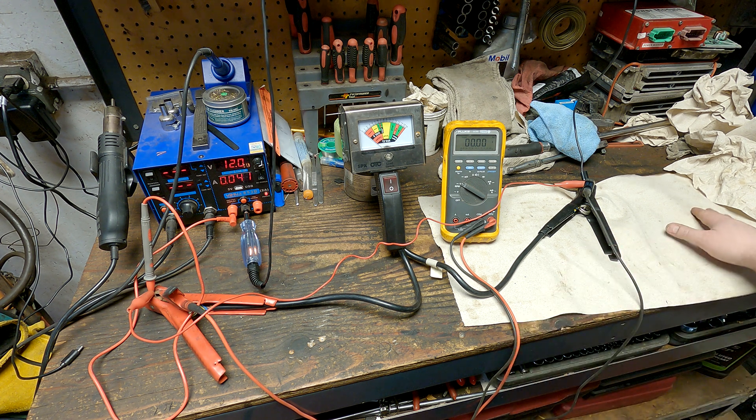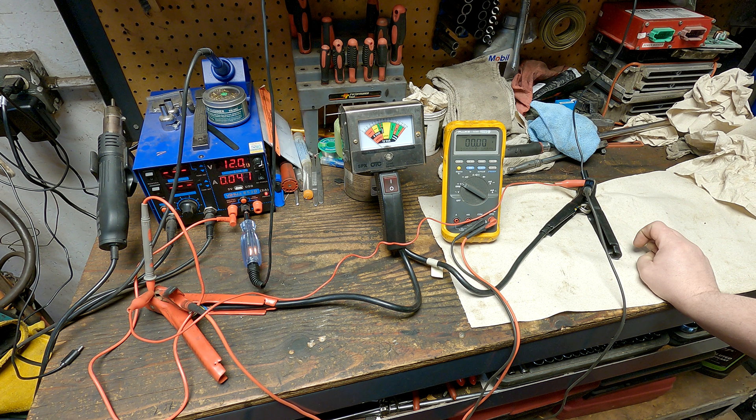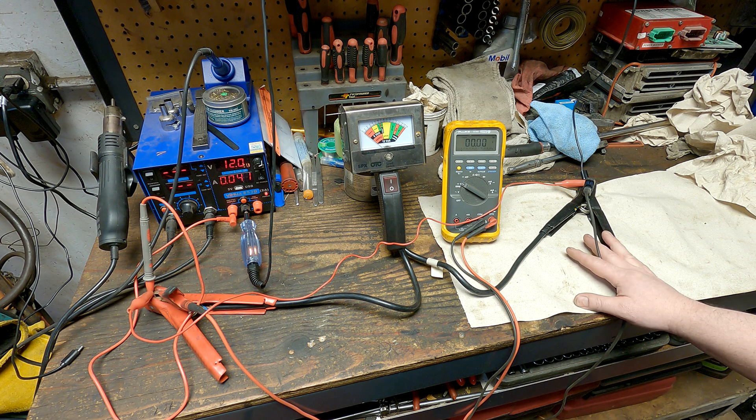That's why tools like the Power Probe are so handy — you connect right at the battery, so all your voltage readings at the tip of the probe are referenced to the battery ground. When you read a voltage with the Power Probe you're reading the difference between the tip of that probe and the ground at the battery. With a regular meter that's not always practical unless you've got a 20-foot lead to hook up directly to the battery. Just understand that if you're testing at a component, you're measuring the difference between your positive and negative lead. Thanks for watching — like, subscribe, comment and tell me what you'd like to learn.